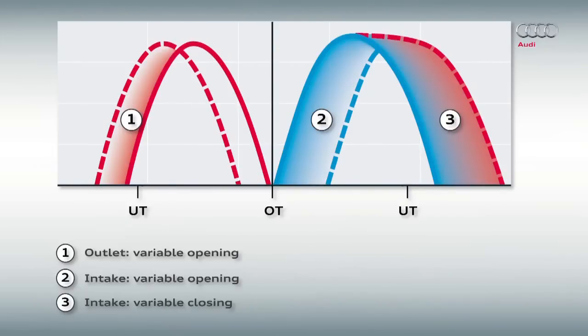We have a short animation about this. This is the normal state — both valves open at the same time. In this case, the rear inlet valve opened at an earlier point. As a longer channel is created, a swirl is produced. We looked at the swirl phases in the first part of the program. The other valve follows at full stroke, so that a stronger swirl is created. When the piston moves up again, the valve that opened later stays open for longer. As such, the aspirated gases are pushed out again.